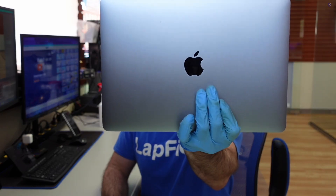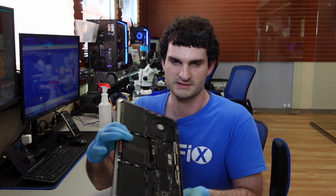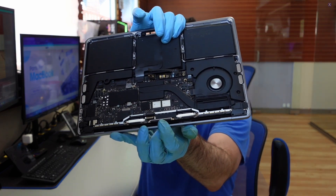We've got one of these M1 MacBooks here and it looks pretty nice, still looks pretty good. We have the board open. It looks like the LCD is disconnected. We did take a look at it first and the issue seems to be no backlight. Usually when you have a problem with a display, it could be one of two things: either the main display has the problem, or it could be a backlight or data line issue on that display.